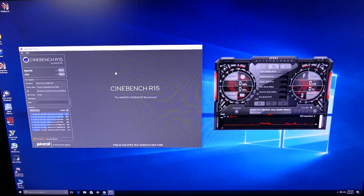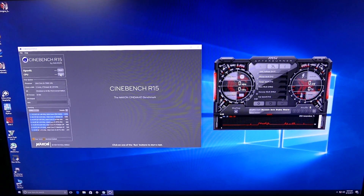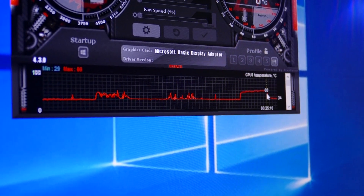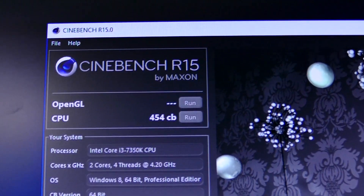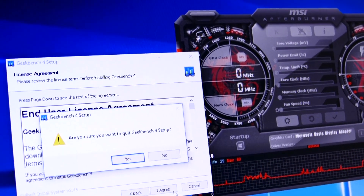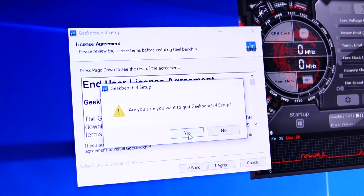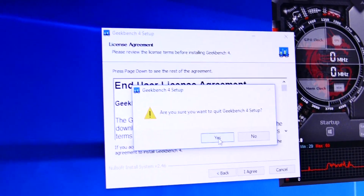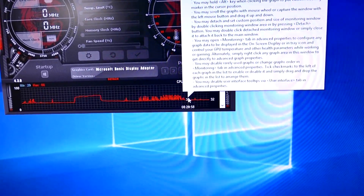This is a beautiful LED combo, by the way. Cinebench first — remember this is with the thermal paste, so temperature should be completely fine here. Running at stock frequencies, and the fan curve is just whatever was in the system BIOS out of the box. Max temperature with Cinebench was right at 60 degrees Celsius. Cinebench score at stock speeds with 4.2 GHz turbo boost was 454CB. Now for Geekbench 4 — highest temperature running Geekbench 4 was 55 degrees Celsius.